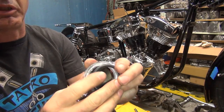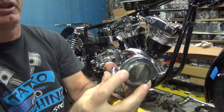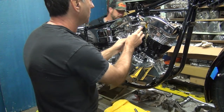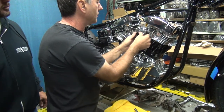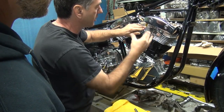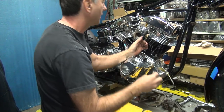Okay, so to get this O-ring in here, we just wrap it around the top here. Like this. And the silver O-ring's frozen. There it goes. Then you just hold it with one finger. The other one will get inside the clamp. You slip the manifold in, rotate it, and just roll the edge back, wiggle a little bit, and the O-ring will self-center. Just like this. You can now install the O-ring. Wiggle around a little bit, let the twisting come out of it. And there, see how that goes in there? Pretty beautiful. Slick, huh? Almost like you've done that once or twice. That was the easy thing to do.